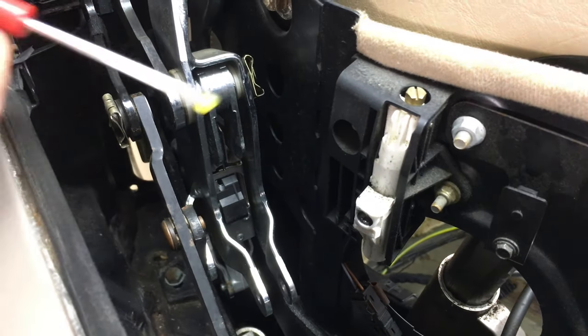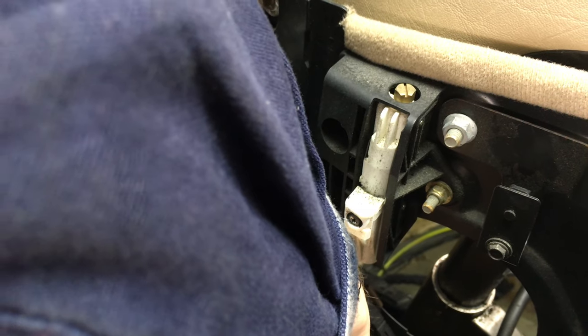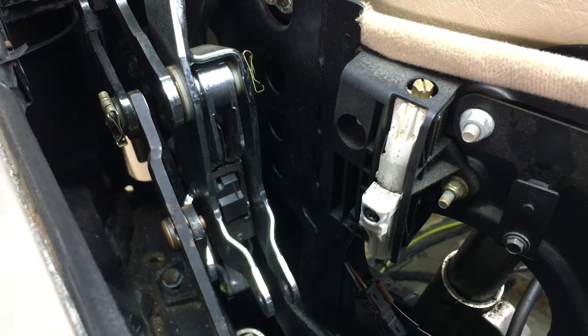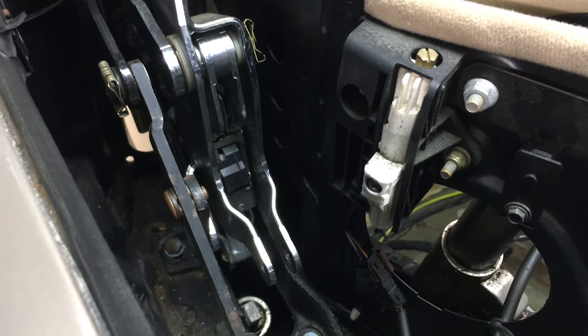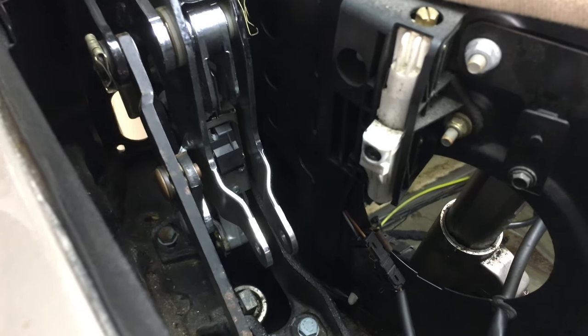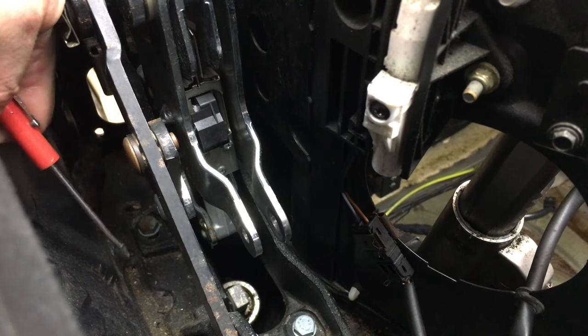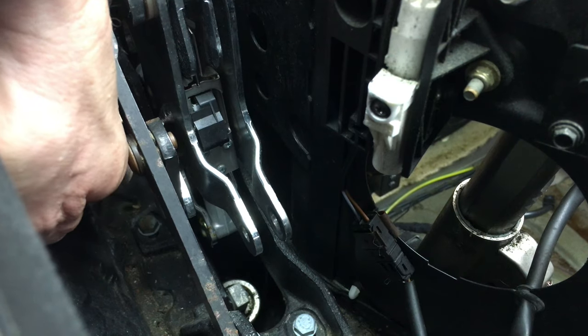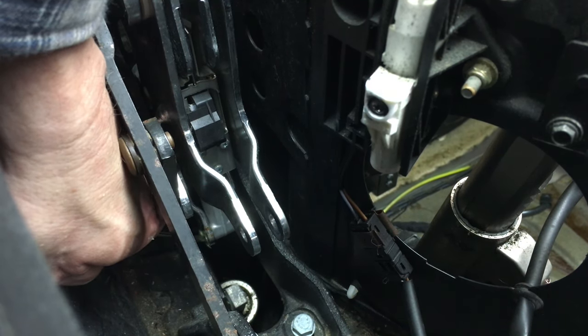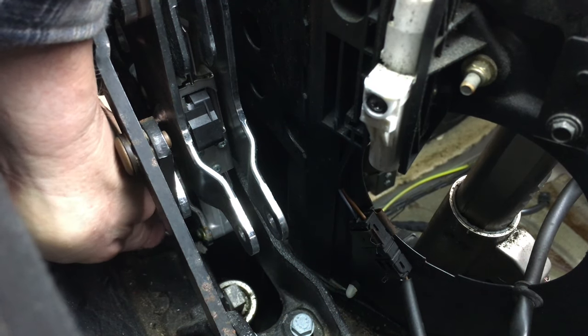The trick is a dab of grease on your screwdriver. Put that down in the area where the circlip goes onto the cylinder and then it's fairly easy to put the clip on. To get the clip to adhere to the surface on the frame, place the clip on the screwdriver — the grease will make it stay in place. Now transfer it over to the frame. You can see the clip sitting on the soft top frame right where it's supposed to go, then just push down on the clip until it's properly seated.